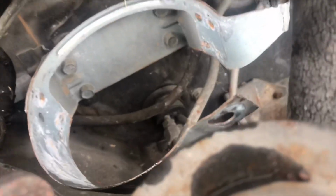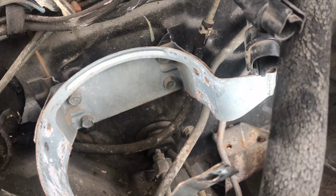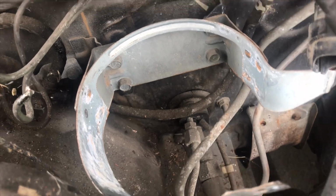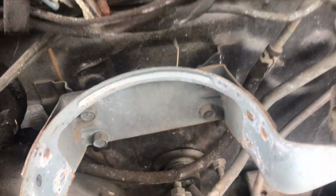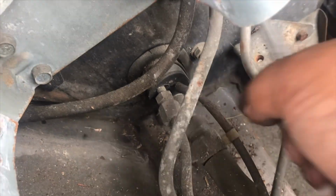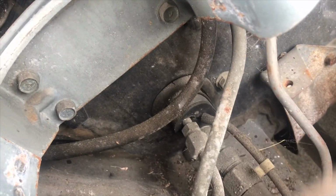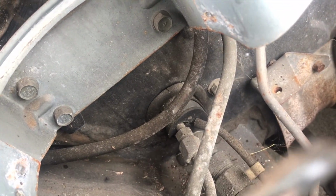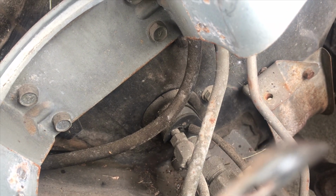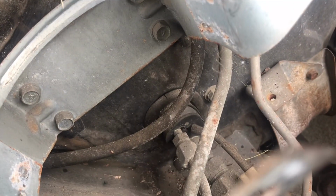And this is what we're looking at. Some 12 millimeters to take this bracket out, and that's about it. We're also going to be eliminating some vacuum lines, but that vacuum line right there, this one here, is the only one you're going to keep, because this actually moves your AC actuator open and close for, I believe, recirculate and fresh air. So that needs to be connected.